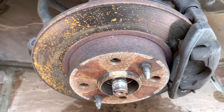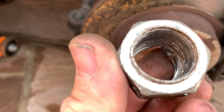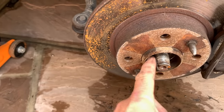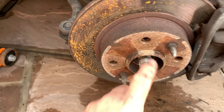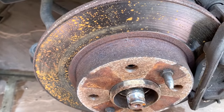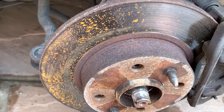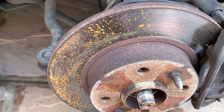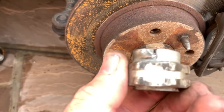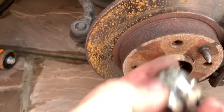I have got a new driveshaft which I got for a previous car. Look at the state of it - it looks like it's completely stripped. So that's probably why it's not going on. So it's whether there is enough thread there for it to take, otherwise I've got to put a new driveshaft on. I'm hoping, because the new driveshaft has got the bolt - look at the state of the edges of that bolt. Obviously you have to bend these tabs back when you take this off. So it's obviously had a new driveshaft at some point. It's had a new drop link as well.